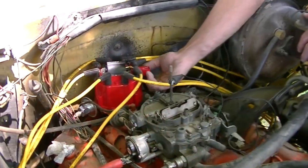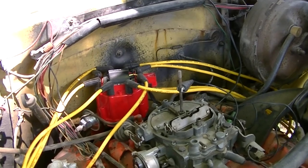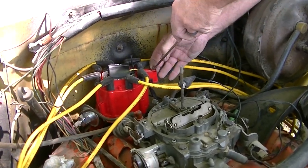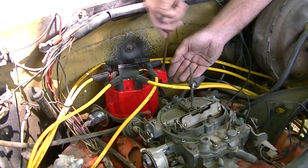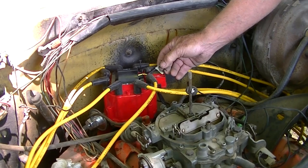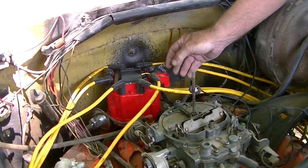It's not connected. He's trying to figure out what the loose connection is in the distributor. If he wiggles the wire that goes into the distributor, he's lost spark. So he's taking it apart right now to figure out what's giving him the issue.